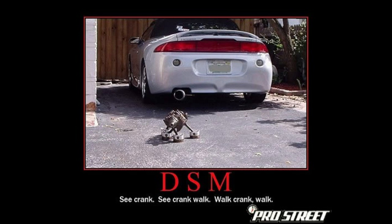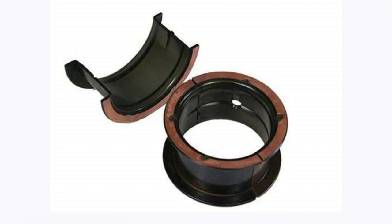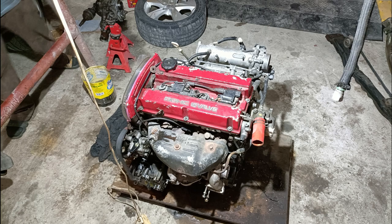Crankwalk is blamed on many factors, but I really believe the opinion of a company called Jax Transmissions, who are specialists on 4G63 platforms, that Crankwalk is basically a lubrication issue due to some inherent design choices by Mitsubishi. Not enough oil gets to the main bearings, and on the 2nd gen 4G63 where the main bearing and the thrust bearing are the same integral unit, the lack of oil also wipes out the crank thrust surface — causing Crankwalk and untoward destruction on many aspects of the bottom end. That's what happened to us with our EVO 4 engine.